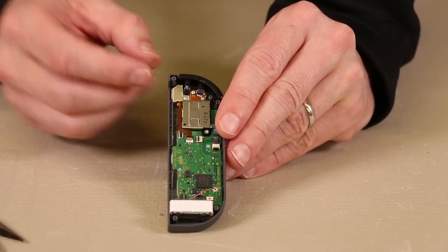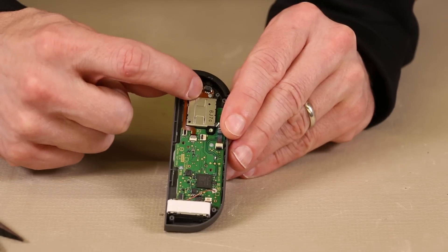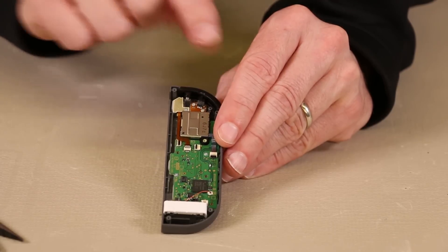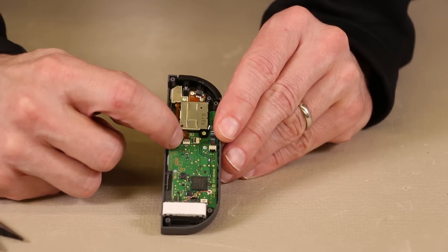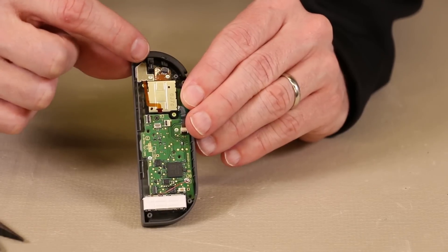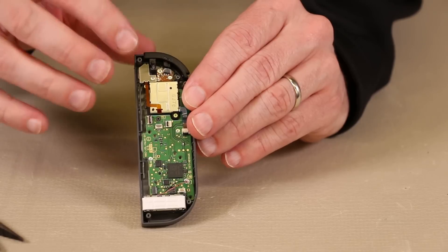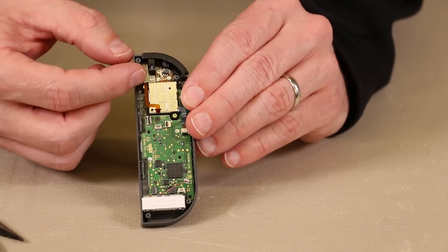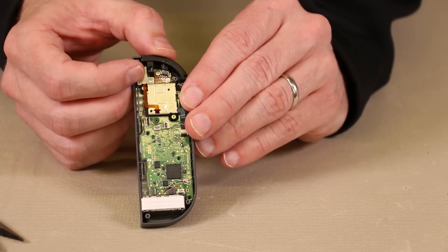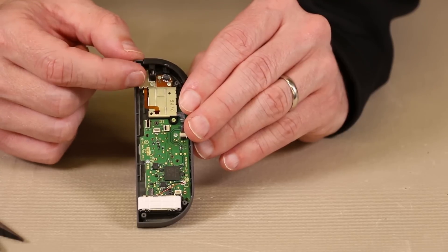And there we have it. Next, we're going to remove the minus button, which is right here, and the L button, which is right there. They're connected by one Phillips screw here, two Phillips screws here, and this ribbon cable that goes down to the white connector with the gray locking tab. We'll also remove the L button itself, which is not really held in by anything, so you have to be very careful to remove it and get the spring out that comes with it. There is a spring there that pushes the button back after you push it, so we need to make sure that spring is not lost and stays intact.